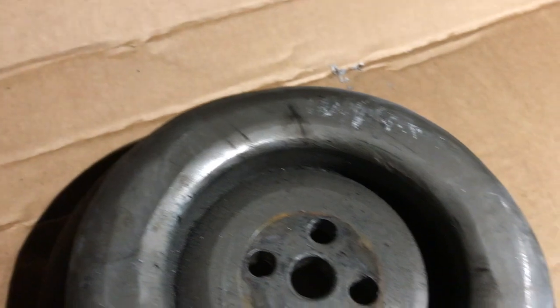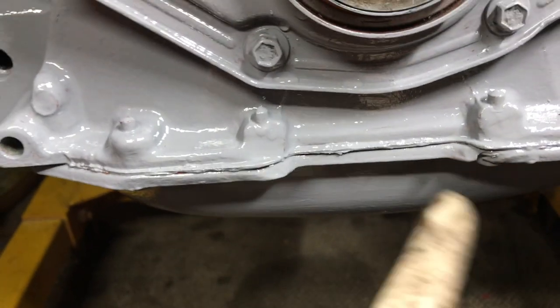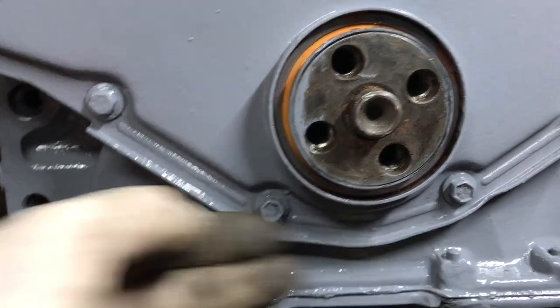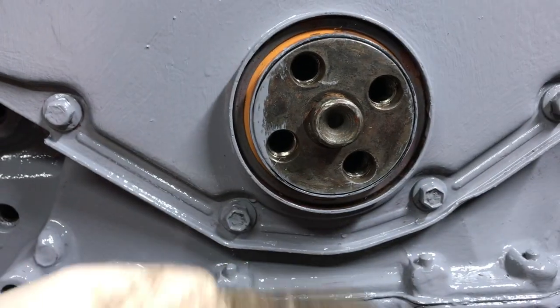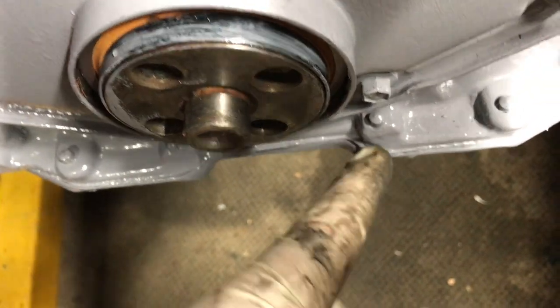You're going to have to do this to it. You just put a nice curve, and you test fit, and all that good stuff. I'll show you the front timing cover — I did have to mod it just a little bit. So besides my paint holidays here, this thing needs a little clearancing. When people say your timing cover and your oil pan are the issue, this is what they're referring to — this area right here. You've got to make sure that's out of the way. This clearance right here is the problem that people have, and you can see that it juts out quite a bit.